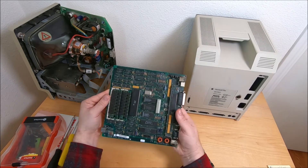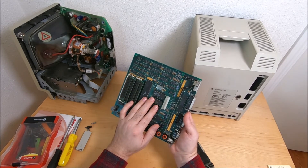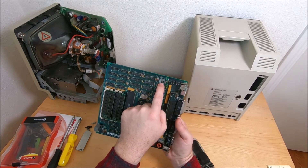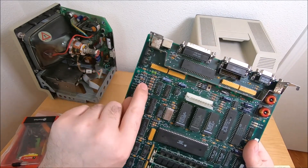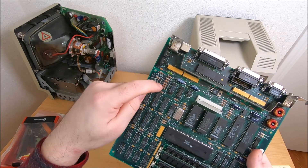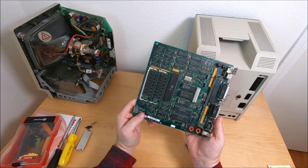The board I already cleaned, and I installed memory — it didn't come with memory. I installed one megabyte first on the Macintosh Plus and it didn't boot, didn't work the way it should. Then I discovered the previous owner had cut the R8 — at some point you can see there was solder there, meaning someone cut it and then soldered it back together, then disconnected it again. After I put in four megabyte RAM, everything is up and running the way it should be.